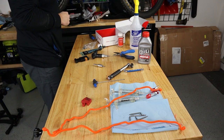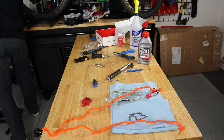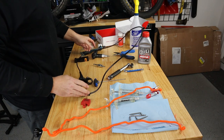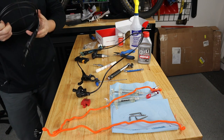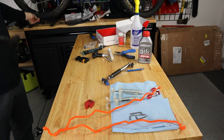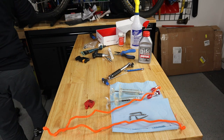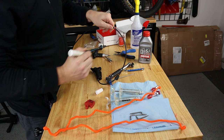I'll use the old brake system as a benchmark to mark and cut our new brake system down to size. I'll use a white grease pen to make a mark on the cable where the new one needs to be cut. Here's our new brake system — let's compare hose lengths and get our new measurement. We're marking at the lever end of the hose because we're shortening from the lever in.